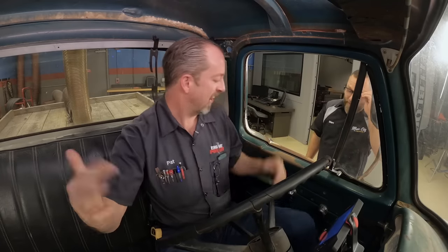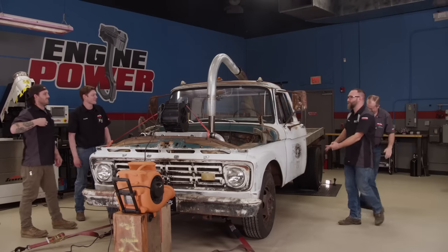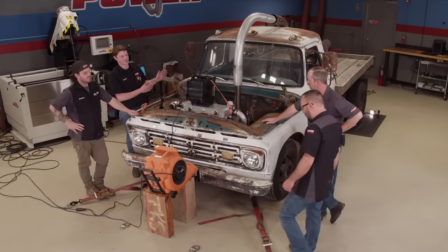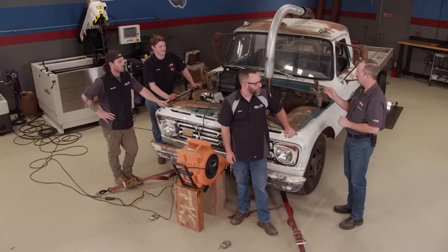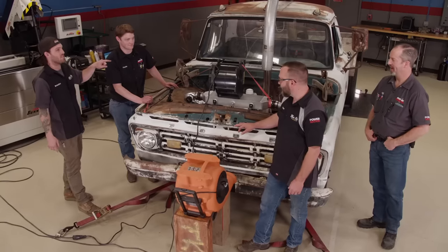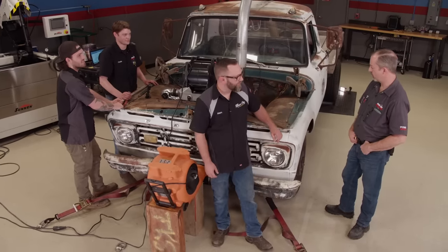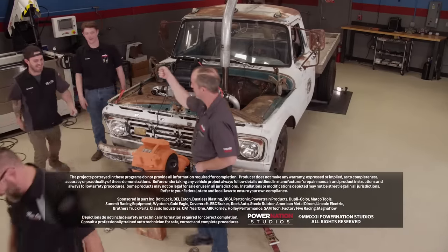It makes it so hard to dyno because you have to load it so much just to get it to climb at a reasonable rate — it needs like a 4.10 gear. It's just printing numbers — 373. Nice, 373 and 373 — that's what it's supposed to do. It would do that all day long. We're at 75 miles an hour wheel speed, and that felt like 175. You're almost at five times the amount of horsepower you had before — mission accomplished! The only thing I would change is the steep gears in the rear — I'd go to like a 4.10 and this thing would just scream down the highway. This was a lot of fun, great install, nice hustle!